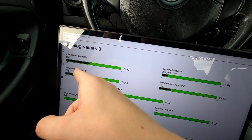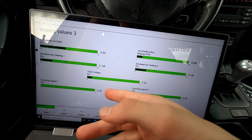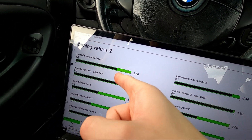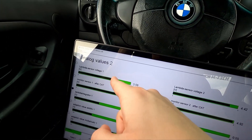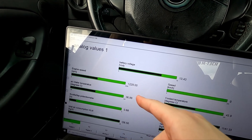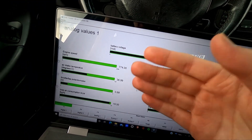Reading other data: you can see camshaft sensor degree, O2 sensor one and two heating — these are pre-cat. The knock sensors look fine, not really knocking, which is good. Looking at O2 sensor voltage, that actually looks a bit low — it should be higher — so that might indicate an issue. After-cat sensors look good. Battery voltage is good, engine speed is 768. Giving it revs it revs up. Coolant temp is currently 46 degrees and going up.